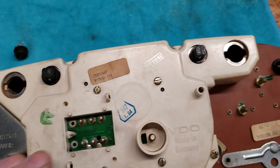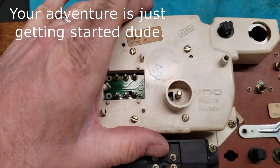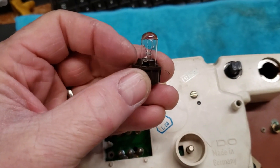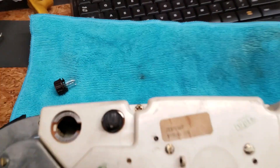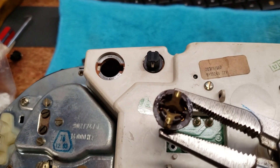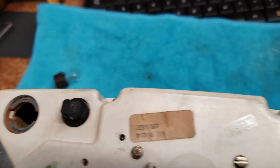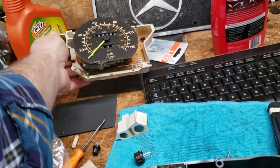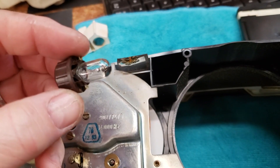Just to document what's going on here, I'm having a spot of bother with these dash light receptacle holes, so I'm going to go ahead and take this cover off and see if I can look at the back side of this board, because these contacts are just not making contact. I removed the speedometer and it actually came out really easily, so I'm going to set that aside. The dash lights are my problem — I'm not making contact for some reason.